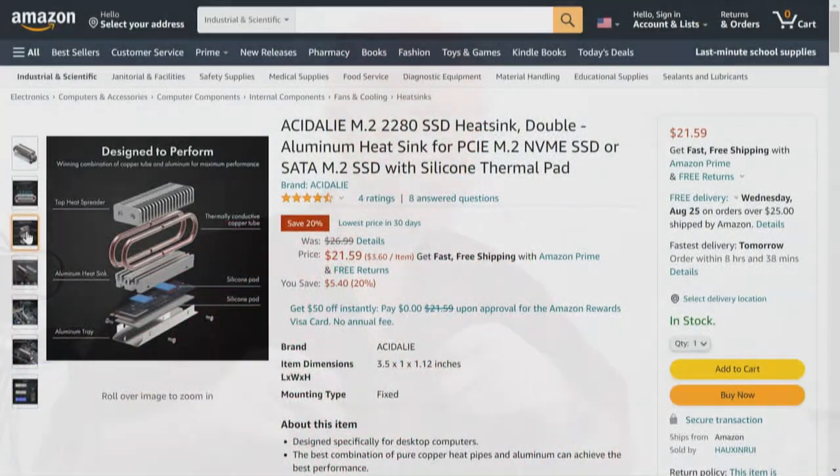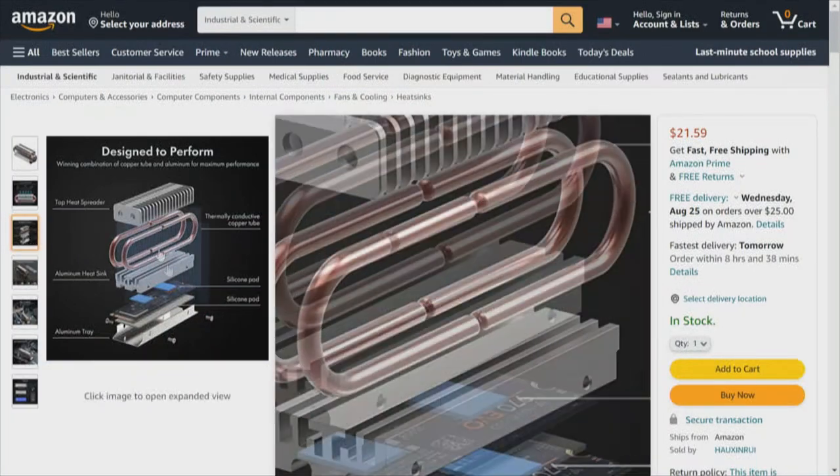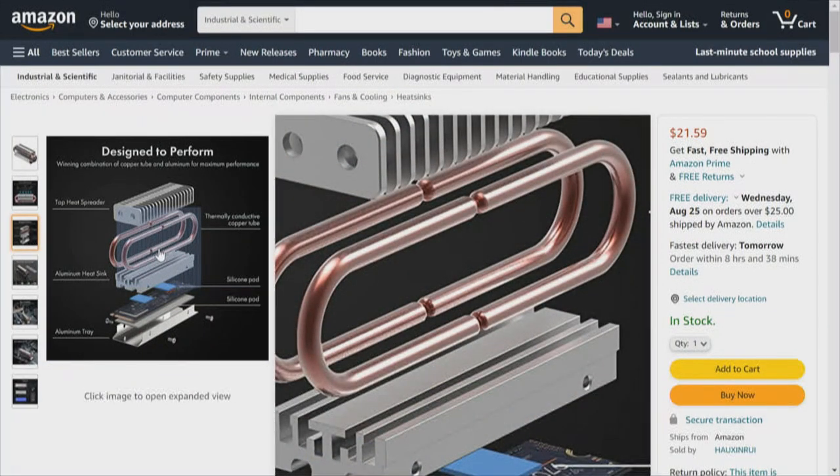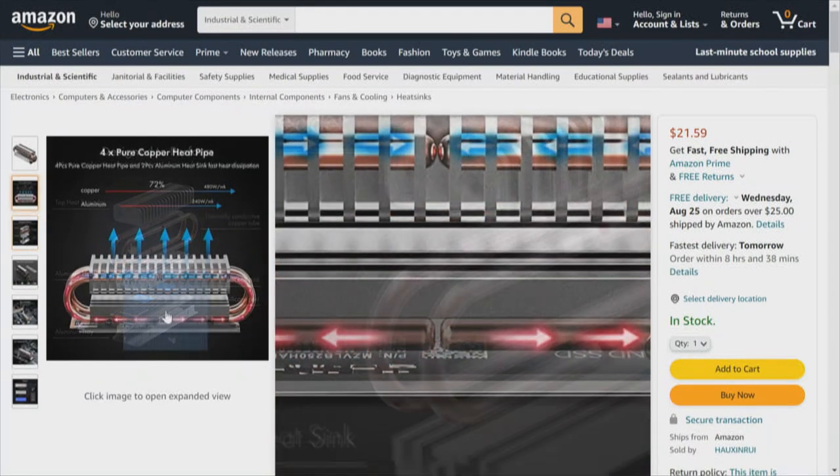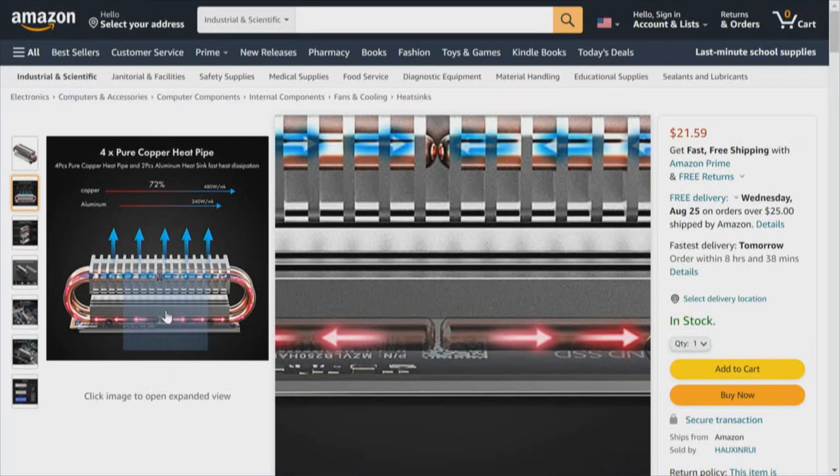But the way they describe it, and we'll look at it in the description, shows it as actually four heat pipes because the heat pipes underneath don't connect. Looking at the drawings on the left, you can see those heat pipes. They go up and they go down, but they don't connect. So it looks like there are two heat pipes, but by their description, there's actually four. What we need to know is, by their definition of actually being four, showing heat transferring left and right, instead of a continuity through the circle, what kind of numbers are we actually going to see?